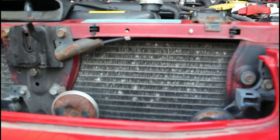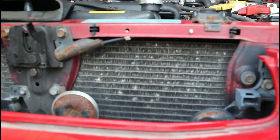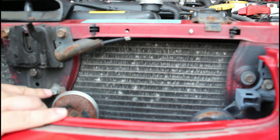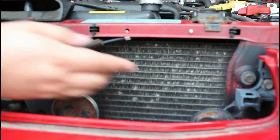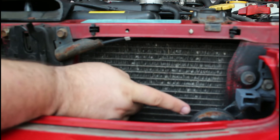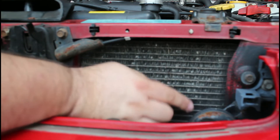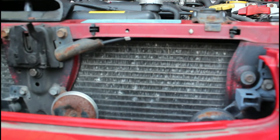The next step — we get to the car. Here we are at the front of the car. The first thing you're going to have to do is get rid of the front grill that sits on top of the bumper. Mine just happened to already be out, so I couldn't show you how to take it out. The next thing is to remove this bolt right here, which is a 12mm, and this bolt right here, which is also a 12mm. That second bolt removes the factory horn; the first bolt is to bolt up the Grim Speed bracket. We're also going to have to remove the second horn located right here. I'm just going to unscrew the one 10mm bolt behind the horn and get the horn out, leaving the bracket in.